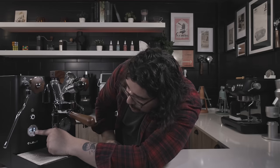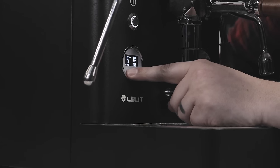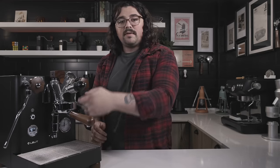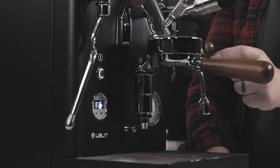At 10 seconds — or wherever you set the low flow to stop — it goes to high flow, until we restart it at 45 seconds and it drops back down to low flow. You also have pre-infusion, which you can toggle on. I want pre-infusion to go for 5 seconds, then I want the pump to turn off for 10 seconds. When we start the shot, pre-infusion runs for 5 seconds, then the pump turns off. The pressure maintains in the head and stays off for those 10 seconds, then after 10 seconds it goes back. So you have the capability of controlling pre-infusion and a rest period — it automatically turns the pump off and lets water infuse through the puck.